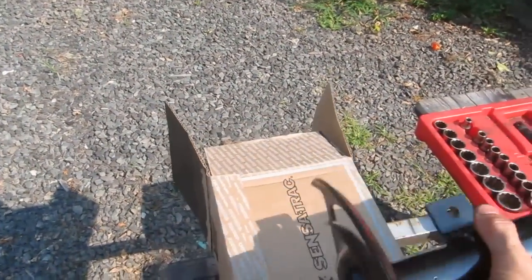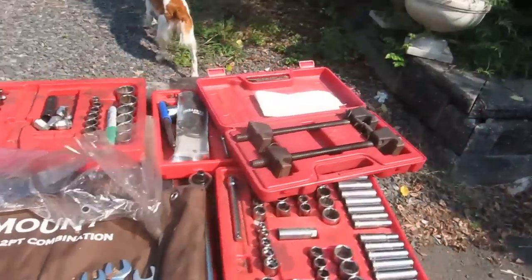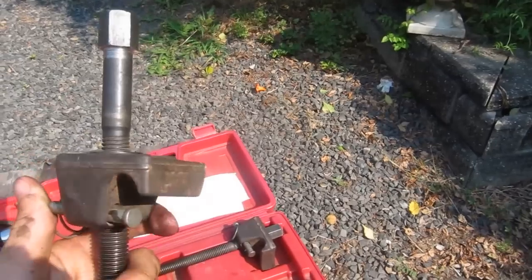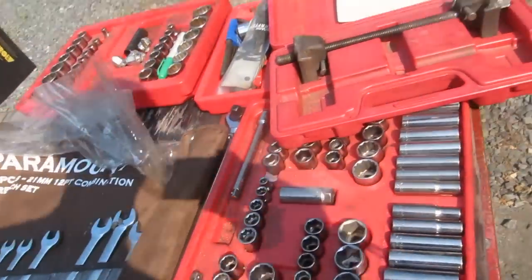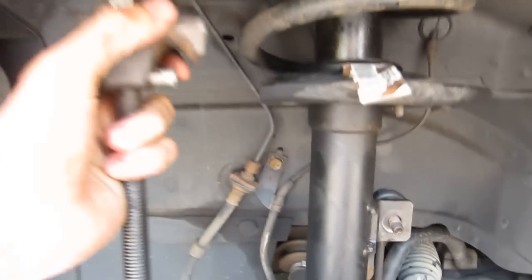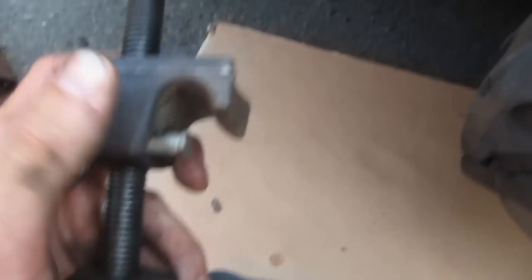Here is the new strut — as you can see it has no spring, which is why most people don't replace these themselves, because you need one of these spring compressor tools. Luckily you can get them at AutoZone. Basically it's just a little thing that goes around your spring — it has a safety pin that locks under the spring. You put one on one side like so, clamp the other one on the other side of the spring. It's going to go up there like that — the bottom will clamp on the spring. It's kind of hard to show you with one hand. It's going to stand something like that on the spring — maybe I'll make a separate video for that. You just turn this nut here.